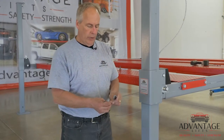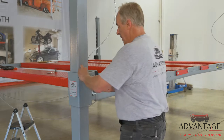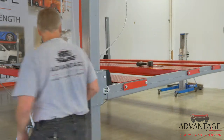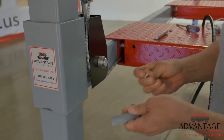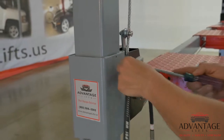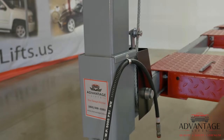Next we're going to put on our keepers to keep our sliders in place so when the lift goes down, the sliders don't come out. We've got a little Phillips head screw with a washer and then our keeper — it goes right onto the outside. Tighten that up and now you've got a ledge so the sliders cannot slide out when the lift is going down. Do that on all four posts on both sides, two per post. On this inside one, same bracket and screw, but there's a hose going in here — this is the one that connects to the port — so we'll put the hose in that little keeper to hold it in place and keep it from getting pinched on the outside of the lift as it goes up and down.